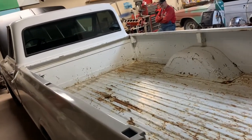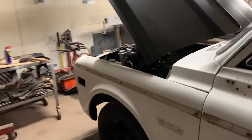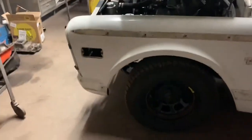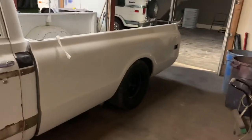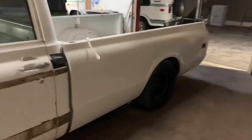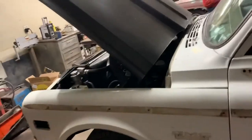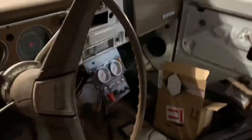It's got a constant pressure B&M valve body in it too, so you don't have to adjust the TV cable on that 700R4, which is pretty cool. We've got this rocker to fix down here, which is not too bad. We're going to fill the fuel tank hole because he's got a different fuel tank. We actually painted this side of the bed about a year ago — it got hit, so we put a new bed side on it and painted that. We'll just mask that off and match that paint. We need to decide what we're going to do with the hood — leave it black, or go white. Let's go white, and Kyle wants ghost flames. Oh, there you go!